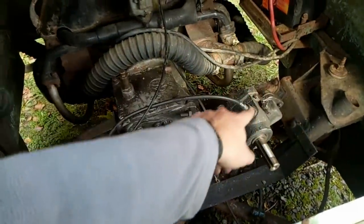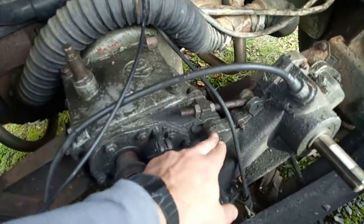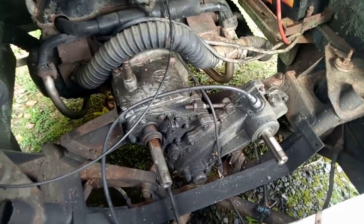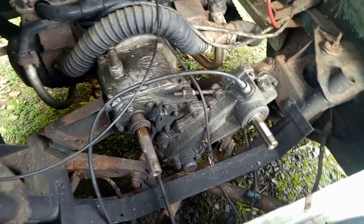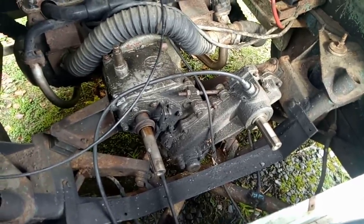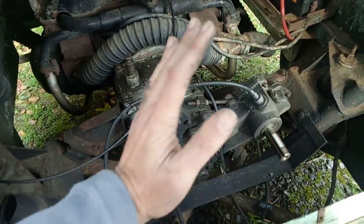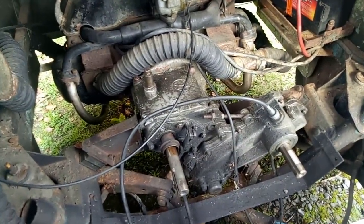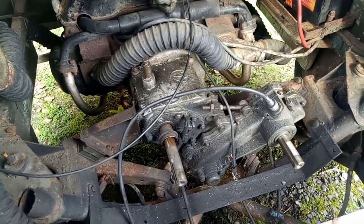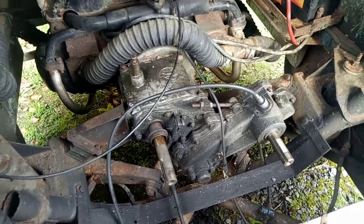You can adjust the position of this chain case using these slider controls here, and that allows you to adjust the tension on the belt. I might just make sure those bolts are all in a decent state and ready to come undone, because the new Kawasaki belt is a bit longer and I might need to move that away to increase the gap between the two pulleys. I'll assess how they look first and take it from there. Let's see if we can get everything back together again.